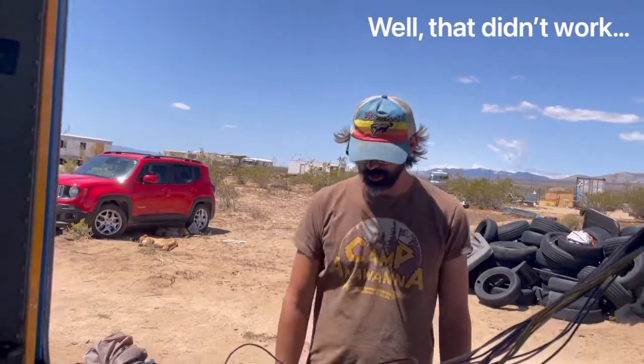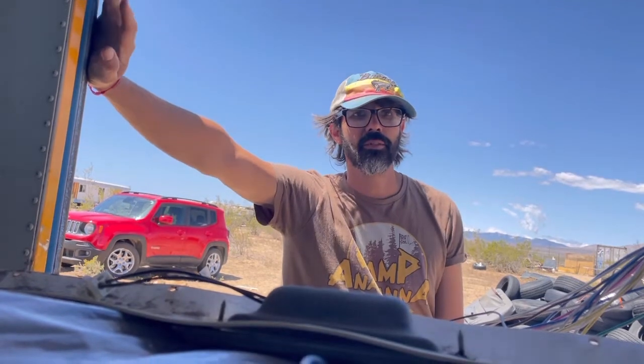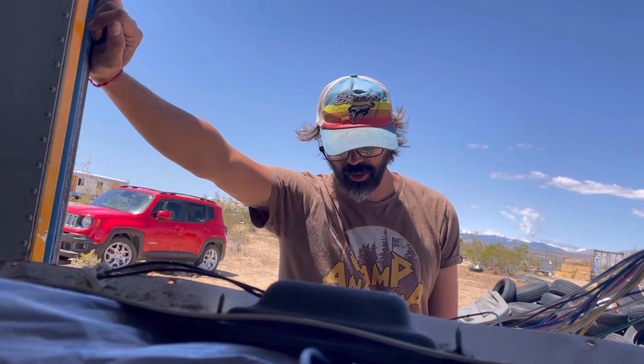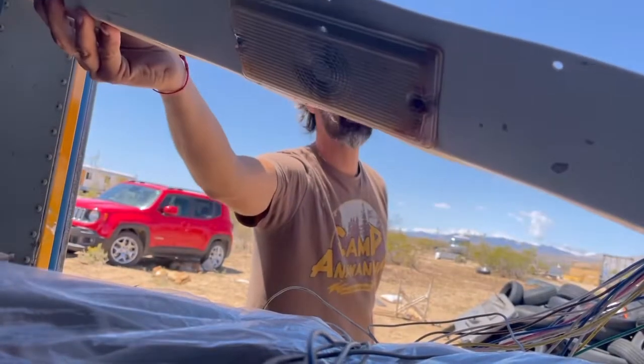Thankfully our friend Josh gave us a nice jump because our three batteries for the bus died. We powered it up last night around 10 before we went to bed, and when we tried to juice up the bus it did not juice up. Thankfully my friend had an AGM battery — he had two of them and he charged up my bus. That means there's a parasitic draw somewhere, probably from whatever this light is connected to. It has a parasitic draw because it's saying that this bus door is open.